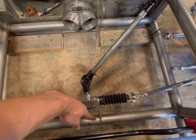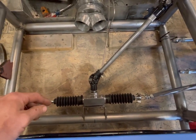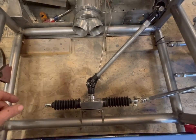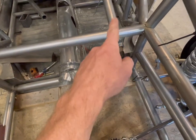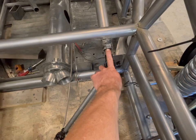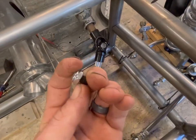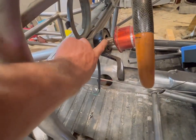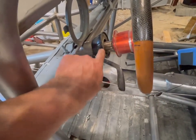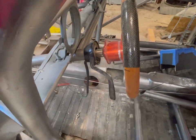Made this bottom mount - it's just tack welded in there for now. This will end up getting a dimple-dyed plate to bring in a little bit more strength, just because this is the main steering support - need that to be nice and strong. Got a U-joint shaft, U-joint, and then the shaft that runs up. I have needle bearings in this section here, so this will get a jam nut and a stopper to hold the bearing in there. Right underneath the turn signal there's another bearing, so that'll get the same treatment. I have to build some kind of sleeve to cover some of this. This is a quick-disconnect steering wheel, which makes it nice and easy.